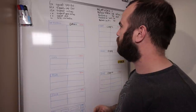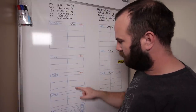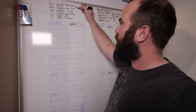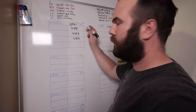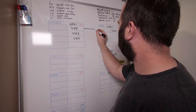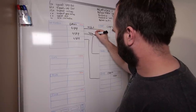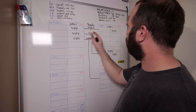Let's see how we can distribute them. This one has 2 power supplies, this one also, this one also, and the other one has a single power supply - but all the power supplies can be swapped out. On core 1 we are going to put in 3 of the 4-port SFP modules, and the other 3 SFP modules will go in core 2, 3 and 4. I am going to make 4-gigabit trunks between the switches. So this is the backbone: 4 gigabit, 4 gigabit, 4 gigabit, and 4 gigabit - all trunks with the fiber optic cables, 4 cables per link.